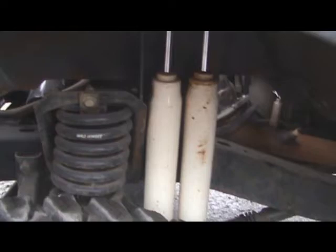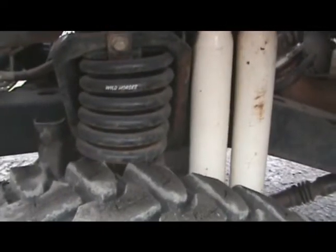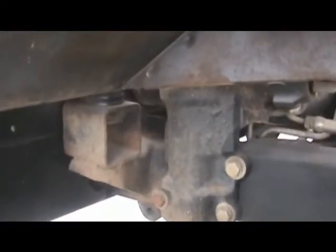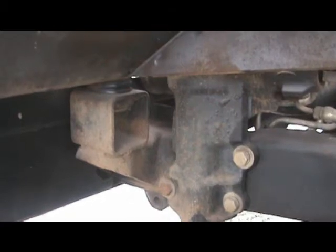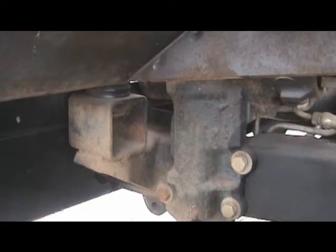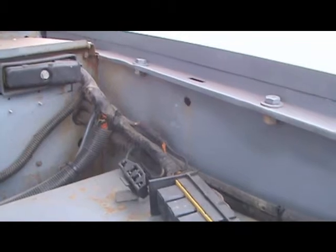They are Wild Horses 3.5-inch lift springs. It has a 3-inch body lift — we did that right. We welded those spacers to the frame and then used standard body mounts so it's a nice solid body mount, which was necessary for some of the modifications. Most Broncos are rusted out right there, but this one is not because those skirts on both sides are brand new — we stuck those in when we built it.